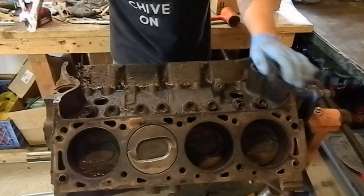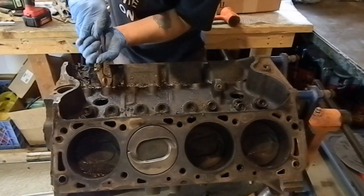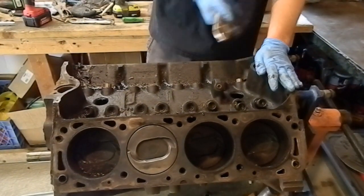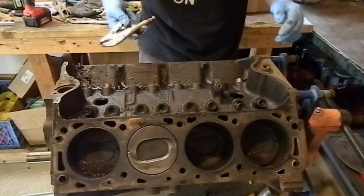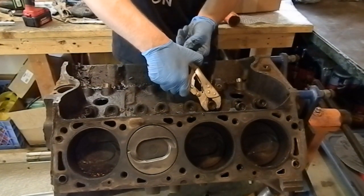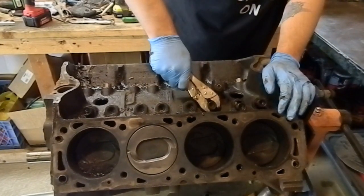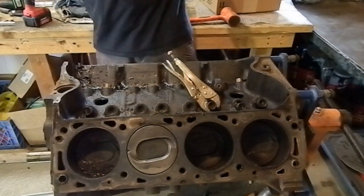Ooh, that's not a good sign. They're either all smudged up, or this sucker has ate some lobes. So what happened is they stopped putting enough zinc in the oil because it shortens the life of catalytic converters. Not Cadillac converters. Catalytic. And so not having zinc in the oil drastically shortens the lifespan of flat tappet cams. There is more friction, but I looked into doing a roller cam for the 460, and it's just really not worth it for my purpose, maybe for yours.